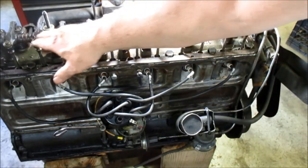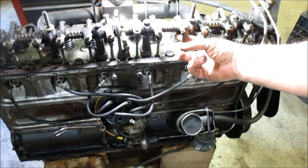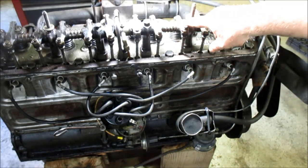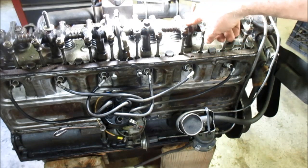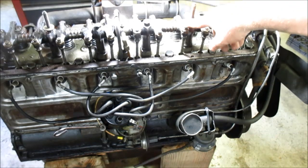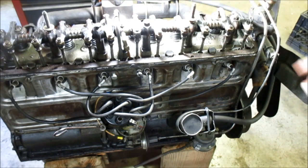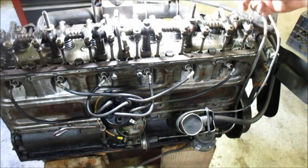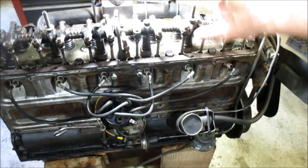And once the shaft is filled, the oil will seep out on the bottom of the shaft, around races in the rocker arms, and out these little holes right here, these little weep holes. Sometimes it could take minutes before you'll see oil seeping out of these weep holes. But once it starts seeping, it's going to seep until the engine stops, okay? And that oil, once it seeps out of here, that means it's already lubricated the whole rocker arm around the rocker shafts, okay? And then it's splashed around.